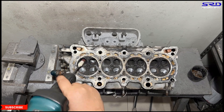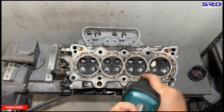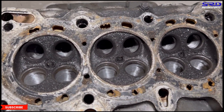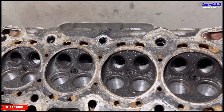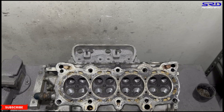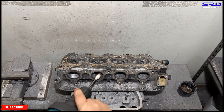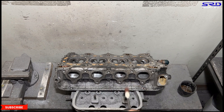Here we are cleaning up the exhaust bowl. We didn't have to go with a carbide because, as I checked it earlier, the movement is all pretty consistent — just a little. Looking closer, you can see there are some areas specifically on the left side we didn't reach with the 80 grit. That's because it's moving inward — we don't even have to reach that. Now let's go with the exhaust port roof. We shaped this with the 80 grit so we can see how it looks when it gets cleaner, and we're going to take it to the workbench after initially roughing up the intake with 80 grit.